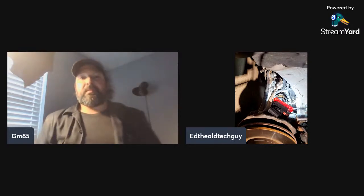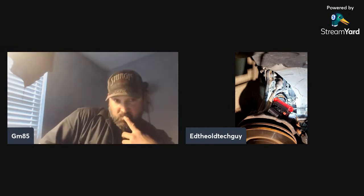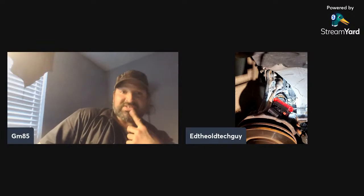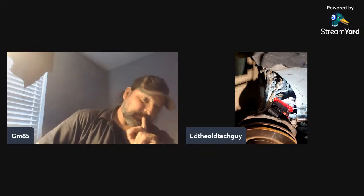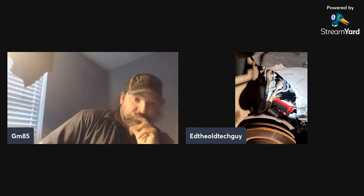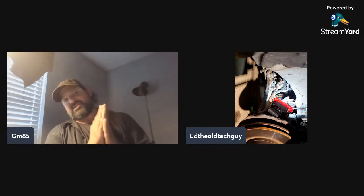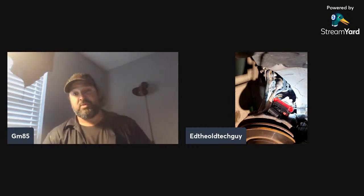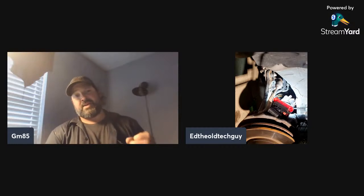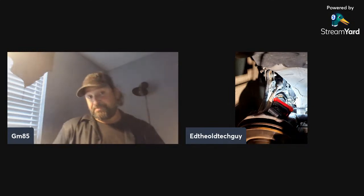So anyways, there's a screen back here, which, believe it or not, the bolt is an Allen wrench. Tell me you don't want to die whenever you hear Allen wrench on an engine. I won't see it good until I loosen this guy, and the only ratchet I could get in here is a quarter inch. We have the stubby Allen key sockets. Or you could cut one down the side and put it on the end of a ratchet wrench, too.